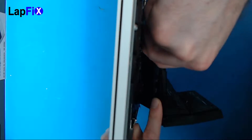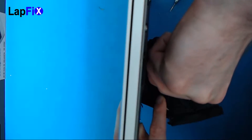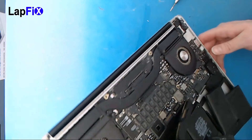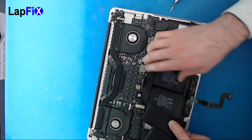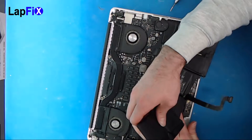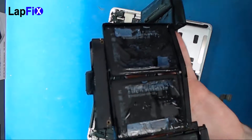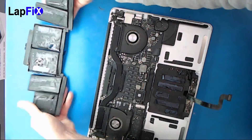It just takes some patience, but I do really think this is a great way. Once you get the last piece, just be very careful when you pull it up. Be mindful of that cable and the board and anything else. I'm going to put it flat so it doesn't pull. It looks like the adhesive is still hanging on a little bit, so don't pull completely up all the way because there is a plate there, of course. And it's going to look kind of like this when it's done — it's a little bit wet, of course, it's alcohol so it's okay. And here is the bottom plate there. That's how you remove it.